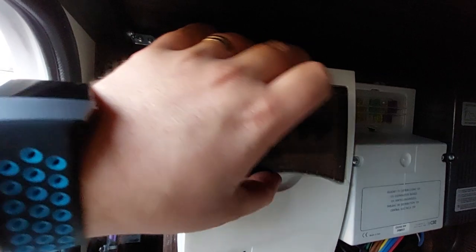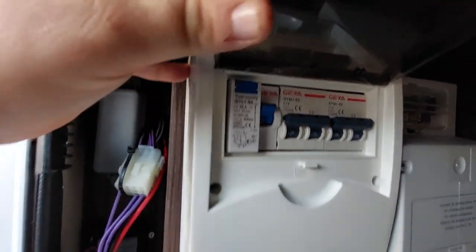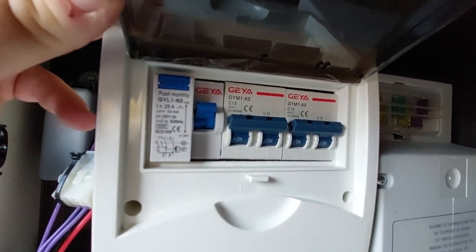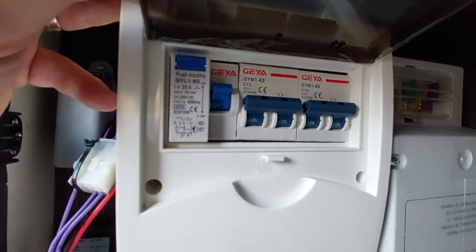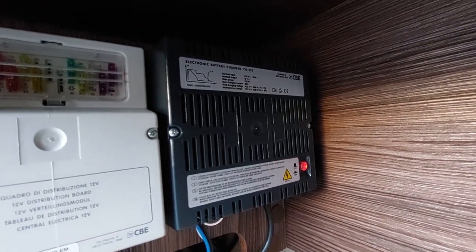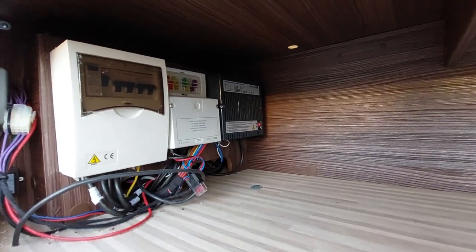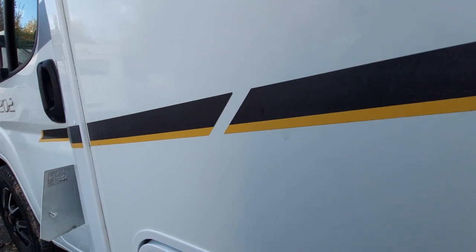In front of that we've got a locker which in here you will find your electrical items. We've got your main RCD box — your test button. You press it and if hooked up to mains it should flick down, plus the other two breakers which are related to items inside. We've got your fuses on the CBE fuse box just here, and your charger point where the orange light must be on to let you know that charge is coming into the batteries from the external power point when you're plugged in.